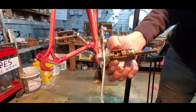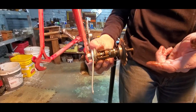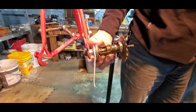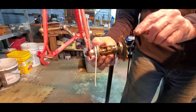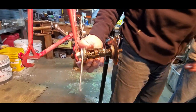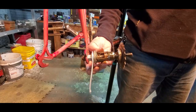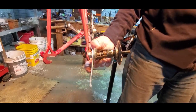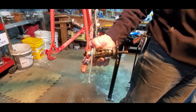Now, this is what makes it tick. You're riding along — as you pedal, this makes the wheel go round. As you coast, it's a safety bike; this all flies by and it just coasts. But whenever you pedal backwards, you see how it makes this go that way? The screw makes it come out this way, but it can't — it would be hitting the frame. So whenever you pedal backwards, what it does is screw and push that in, and the pads get fatter. Then whenever you pedal forward, it comes out and coasts. The whole time you're riding, they're just sliding along, and when you pedal backwards it gets fat — the brake pads come out. That's what makes it tick.